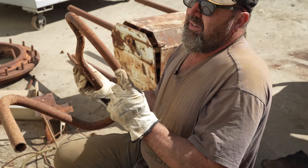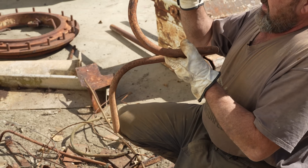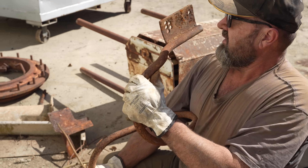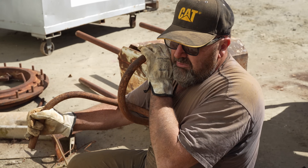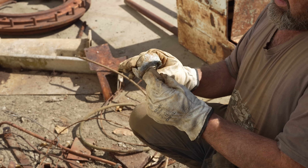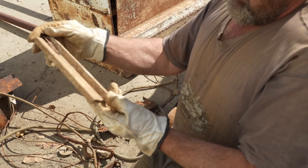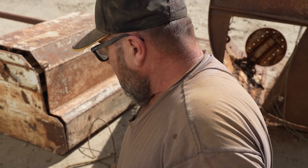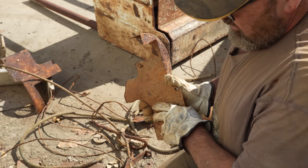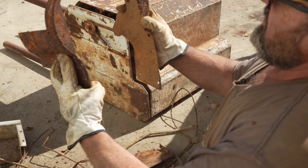This piece with adjusting holes goes on the 37mm — the gunner can position it into his shoulder and adjust the gun up and down manually when he's got the elevation gear disconnected. That's the remains of a tank rear tail light. Another internal bin bracket with a clip on there for the lid to lock down. That cover goes over the drive shaft uni-joint which sits right below the driver — two halves to give a circular shape over the universal joint.